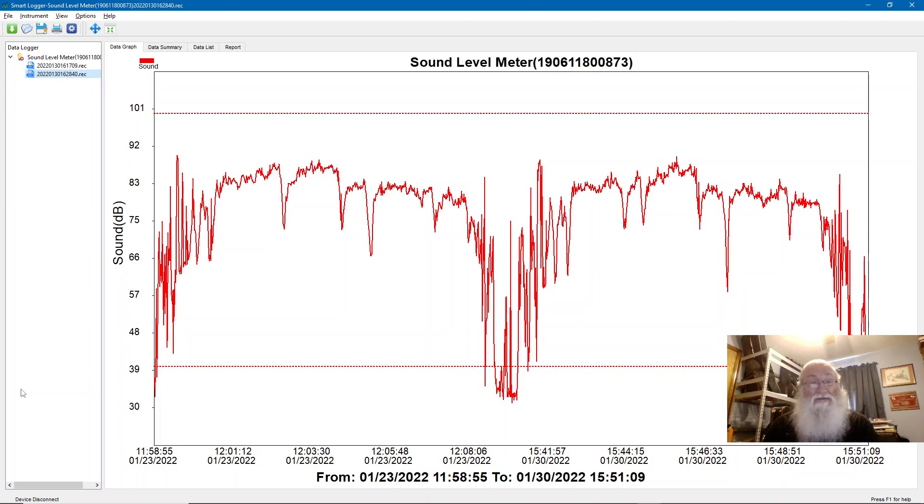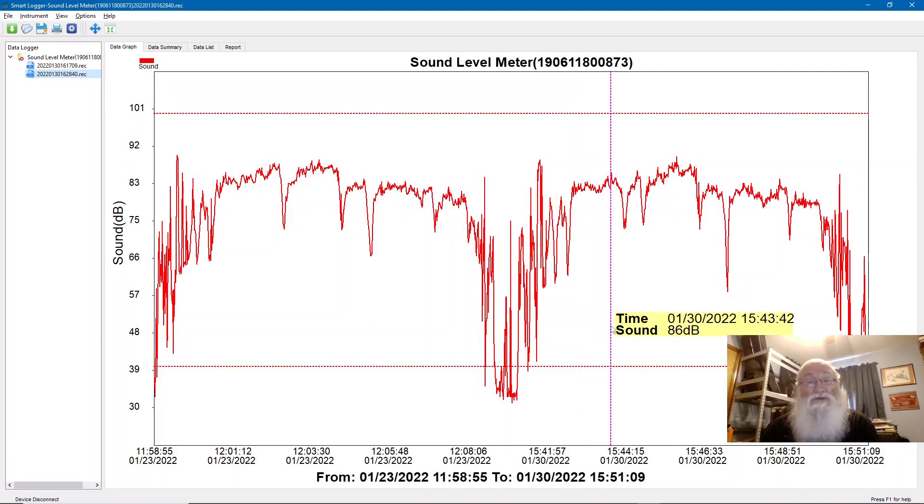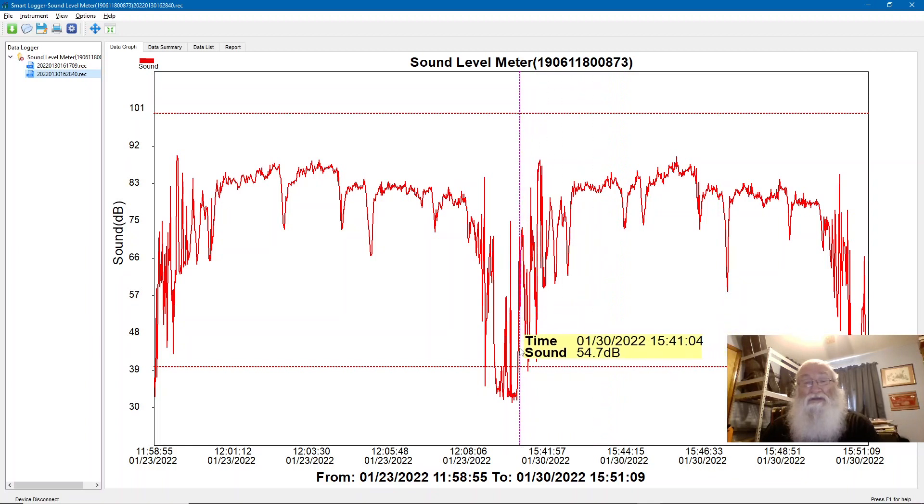Here's the data that I got from my sound level meter on this graph. Both before and after are put together. The first half is before and over to the end is after. I got an average sound level before of 77.4 dB, and then for the second half it was 74.4 dB. So that's a 3 dB difference, which is pretty noticeable. Sound deadener definitely quieted down the vehicle.